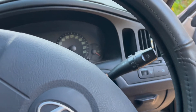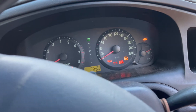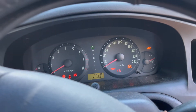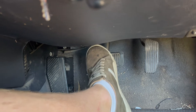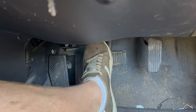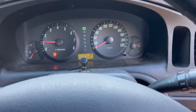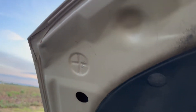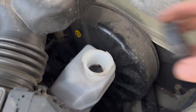If you've come this far and changed your brake pads, before you take it for a drive start the car up and give the brakes a couple of soft pumps - just make sure you actually have brakes before you drive off or put your shitbox into a fence or a house. After completing the brake pads, also check your brake fluid level and make sure that's all good.